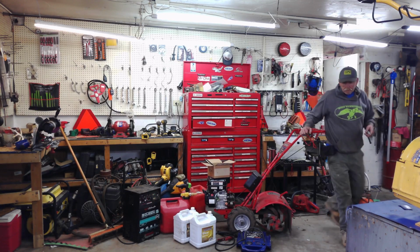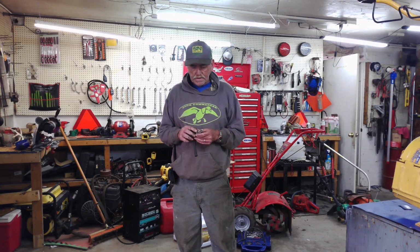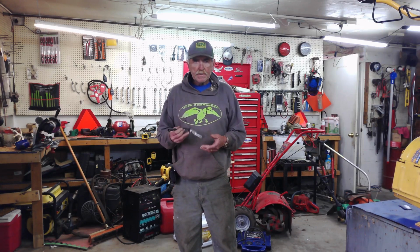And you can get numerous different kinds. I got one from Rotary, you can get one from Napa, Harbor Freight. This is what we use. We had one of these on both sides in the beginning. And the one that was the farthest over that we put on last today was the one that had a nice, beautiful glow. And I even took the spark testers, shut the mower off, and swapped spark testers to make sure it was not the spark tester that was doing it. Because they're cheaply made. They're from China and they do go, but they're like $5 a piece. So I swapped it to make sure.